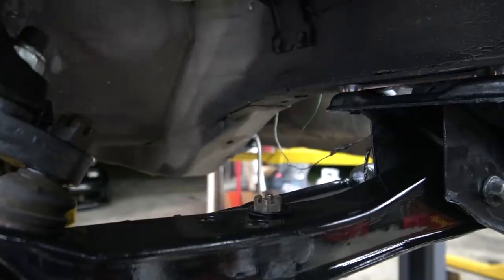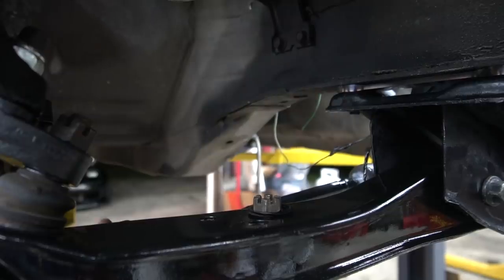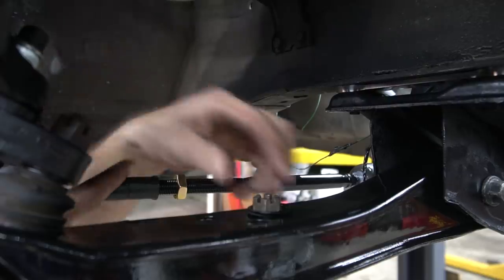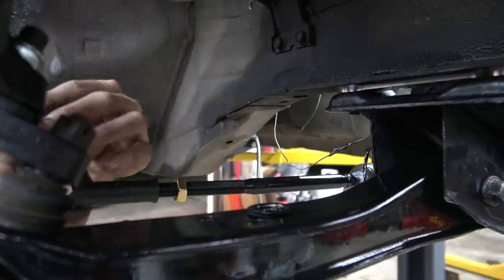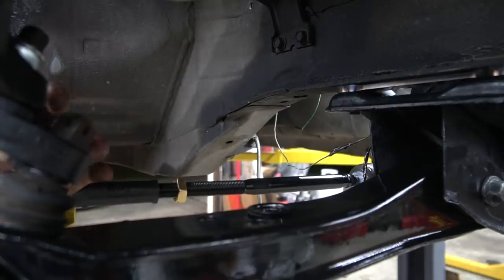All right, tie rods are cut back in. I went ahead and pulled them off the car to do this. I can cut so much better with a bandsaw, especially cutting bolts, because you can cut just right in the middle of the threads. Way easier to not have a jagged, crooked edge. Okay, well, we didn't cut enough off. So cut it a little bit shorter and cut the other one, but for now, this will give us what we need. See how much angle we have.